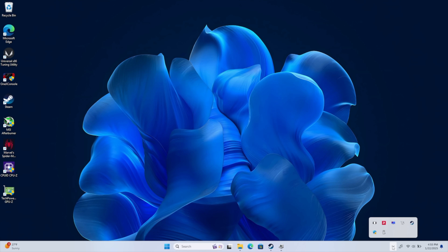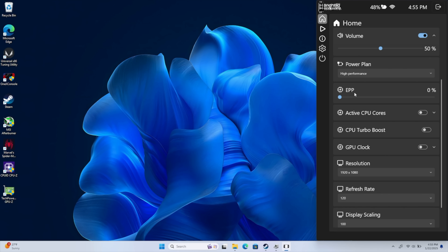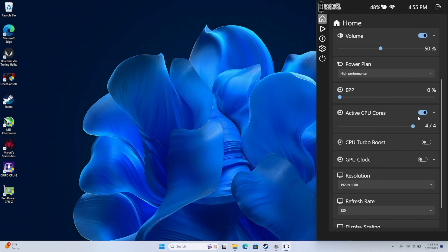Another thing I used here to get the power I needed is Handheld Hardware Tools from Project SBC — I'll leave a link in the description, you can pick this up on GitHub. It just makes it really easy with a nice overlay where we can adjust the TDP. With the Legion Go S they're saying 15 to 30 watts, you can boost the TDP if you want to, and we've got some EPP adjustment. Going to Active CPU Cores, you can see we've only got four — so at least on paper, the way I've got this set up right now is right on par with the Z2 Go chip.